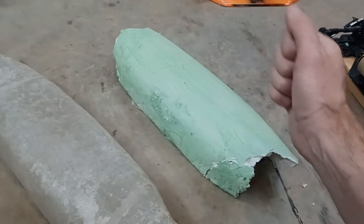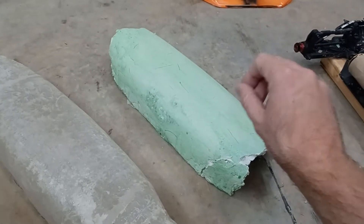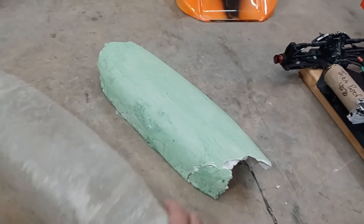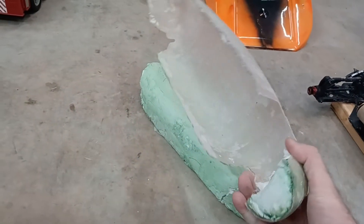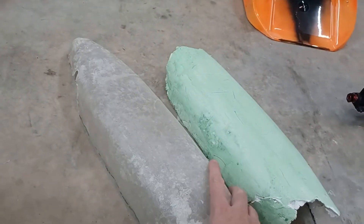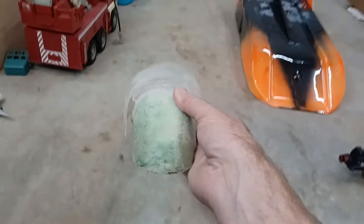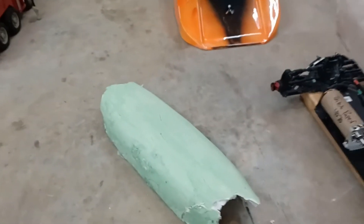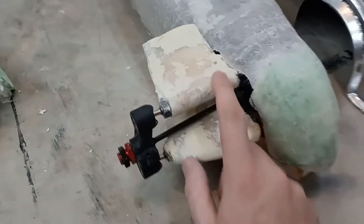You can see there how it fits in the center section — it popped right off. On top of this I put fiberglass using what they call chip brushes, and just patted it down with a polyester resin, which left me with this. I still need to do some body filler and sanding on it, but basically I got this streamlined shape.